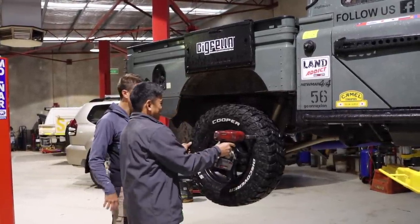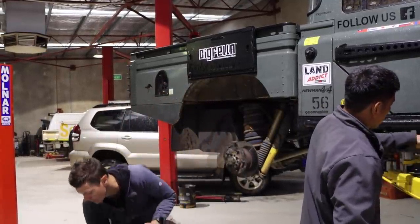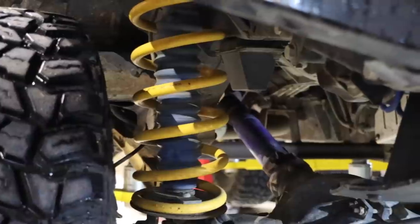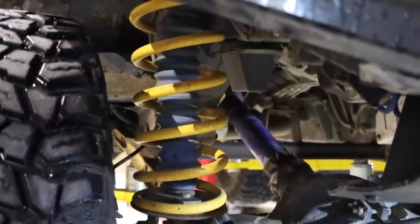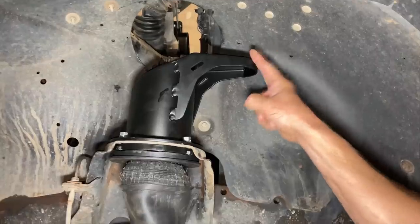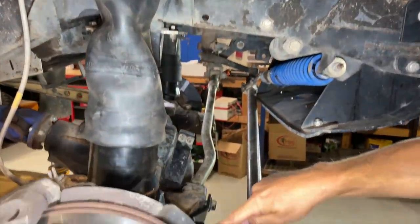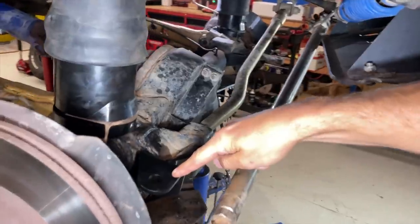Very nice to meet Royal and thank you for helping out — more than helping, he's doing everything. Stephanie made a very good observation, as she always does. The shock absorber is located inside the front coil spring. We're going to have airbags there, completely removing the front coil spring. The shock absorber needs to be relocated using a relocation bracket, moving the front shock absorber to a new location at the top and bottom.